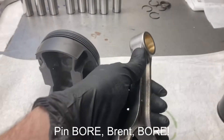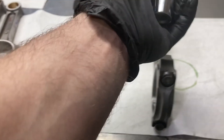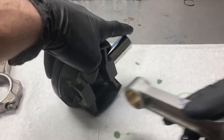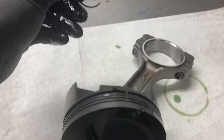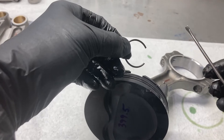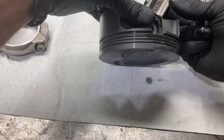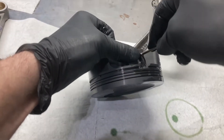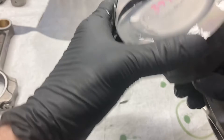Got some oil on the pin boss. I'm going to put some oil in the wrist pin bushing here. All of these wrist pins weighed exactly the same, down to the tenth of a gram — really nice. That went in there really nice, nice clearance. Got my chamfer to the right. Everybody has their own tools for doing wire locks — this is my little wire lock screwdriver. I use it for everything, including spiral locks. You start the wire lock in the groove, and you can use this little cutout right here for a leverage point. Just put some leverage in there and you can hear it click right in. It doesn't take much at all. Number one is done.